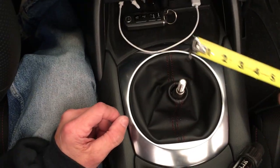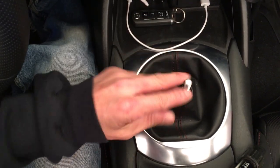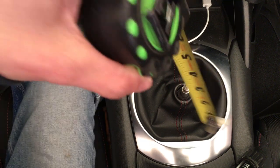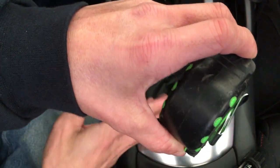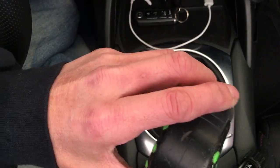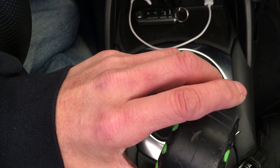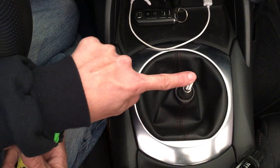So that's all your travel right there. Let's look at the height of the shifter in relation to this cover here. I'm going to put my tape measure straight up perpendicular and eyeball level with the top of the shifter as best I can. The tripod's in my way, there's almost no space in this car. The top of it looks like it is about three and a half inches — so from the base to the top is about three and a half inches.